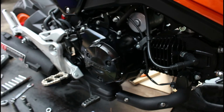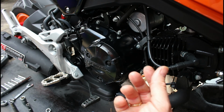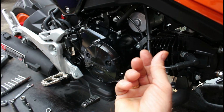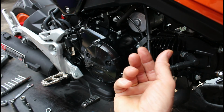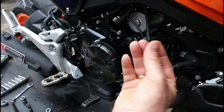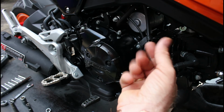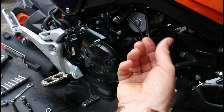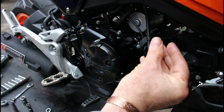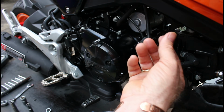Just a tip really, when you put your bolt in underneath that sump, do it by hand. Get your fingers and thumb under there, and when you get the bolt in place, I know it sounds a bit odd, but just rotate it anti-clockwise and you'll feel the thread drop in. Then begin to tighten up with your thumb and finger. The reason you do it anti-clockwise first is so the thread locates into place before you begin to tighten. You'll get a feel for it, and you'll see what I mean when you do it.